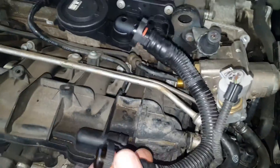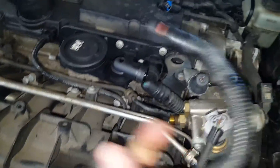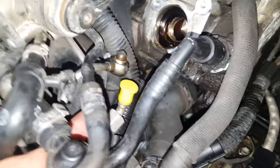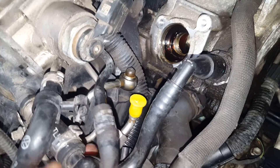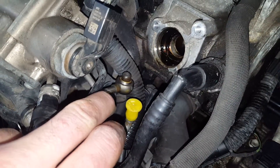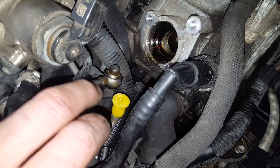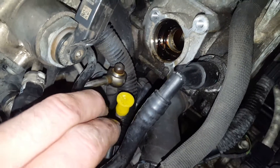I got this hose out of my way — just squeeze down on these and pop those off. They tend to break sometimes too, so watch out there. The hard part to getting this pump off is going to be your fuel connections on the bottom. This nut's a 17 millimeter — that's easy enough. Be very careful when you're taking these high pressure lines off. Have your safety glasses on, wear some gloves in case there's any high fuel pressure in there. When you take these off, it's a good idea to put a cap on them too so you don't get any dirt and debris in there.